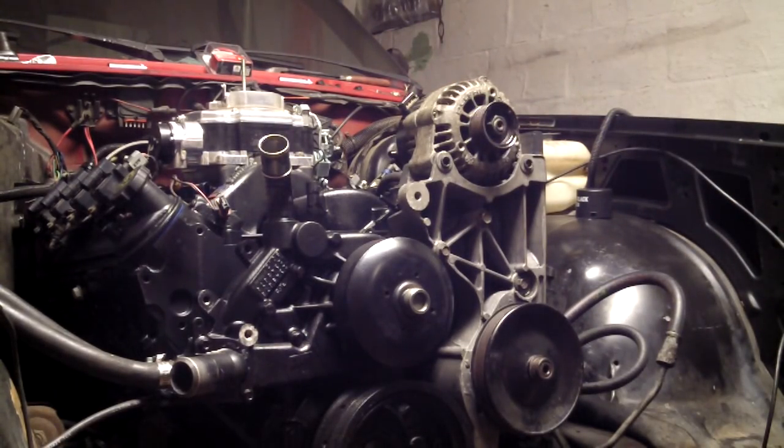A little bit of an update. I dedicated this project to show step-by-step procedures — step-by-step what I'm working on whether it's the cooling system, the steering system, or the transmission. People have a billion questions. We already know I used the eBay motor mounts, Hummer H3, the LH6 pan, and I notched the cross member.